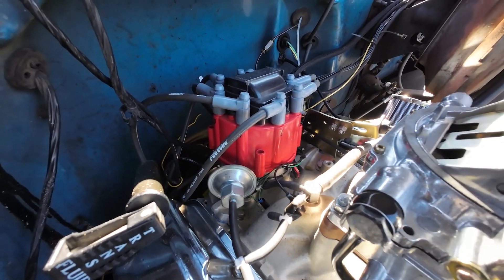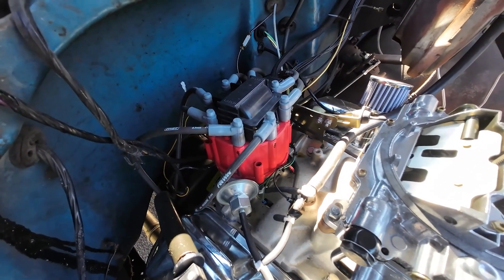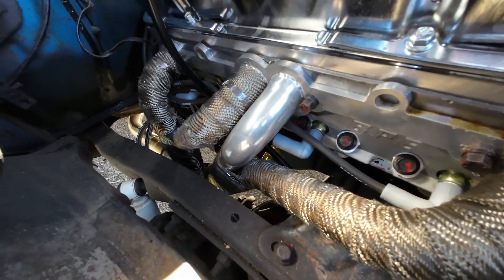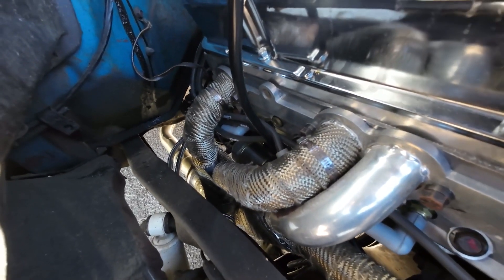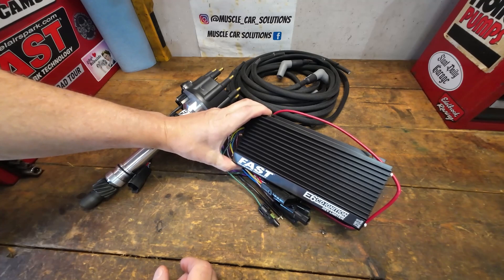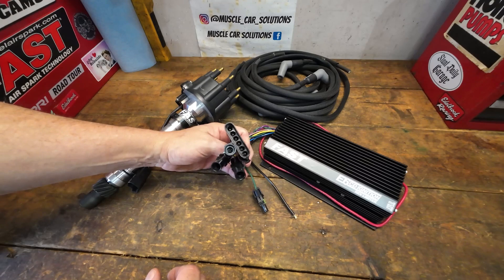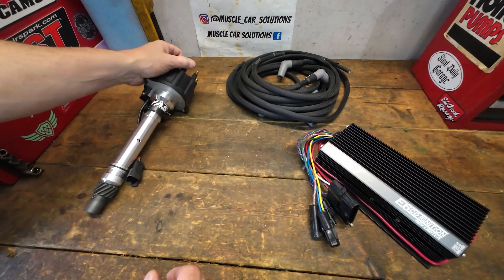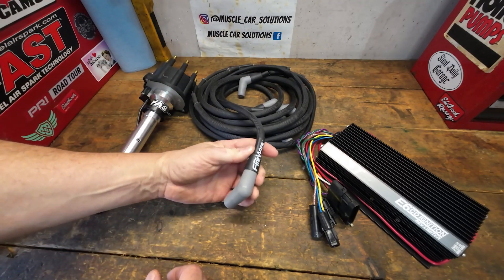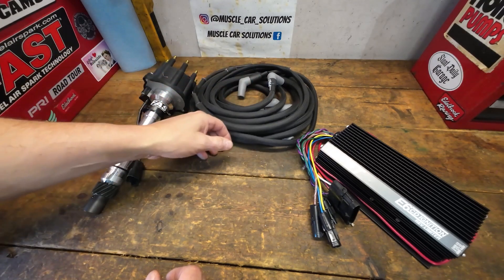Always take elevation into consideration — timing is the number one problem. Right along with that is the ignition system. You've got to have the right system for what you're working on. For the GMC truck, which is just a cruiser, a very standard inexpensive HEI with good wires and good plugs is all it needs. The Chevelle will be a little different — it'll have an adjustable ignition system where I can adjust things with a laptop and make sure there's enough timing, since I'll have a lot more cylinder pressure and more aggressive driving on that vehicle.